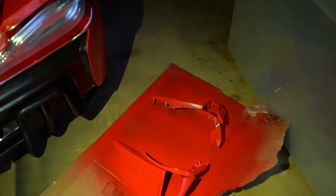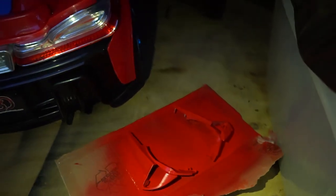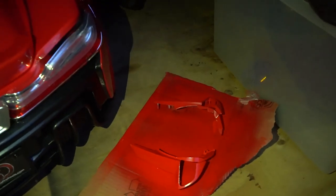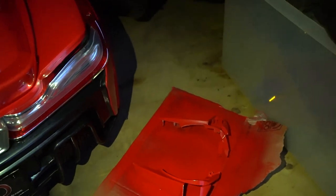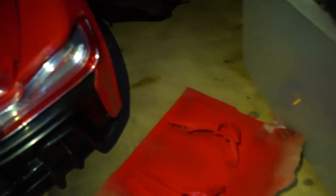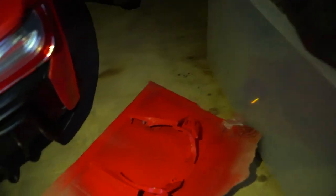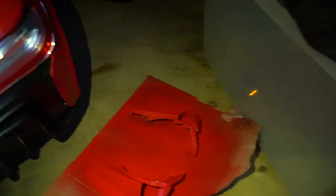I had to put some light on it because I know it's dark, but it's going to stay in the shed for the night to dry until the next day. When you paint something like this - even small plastic or something big - leave it in a secure area with no dust and no wind. Do not ever paint while it's windy or dusty, because you don't want to mess it up.